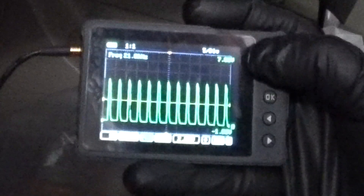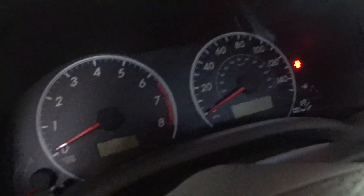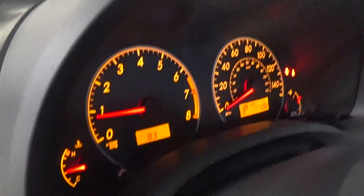Not too pretty — that is definitely not a CAN signal. So I'm looking for the junction block and I need to fit into the car, so I pull the seat back. And guess what — my CAN line is good. I look back at the screen with the Pico hooked up and it's clean. I turn it off and back on, all my lights turn off, the tach works, coolant temp sensor works, and my signal is good.